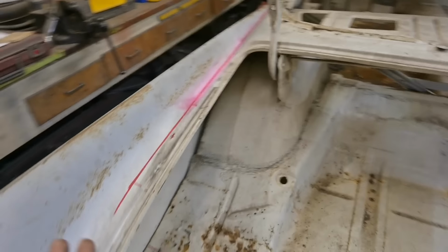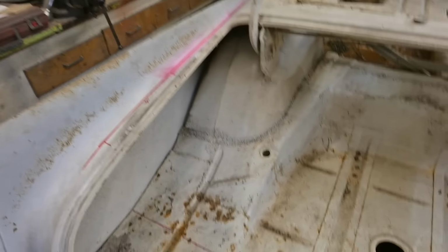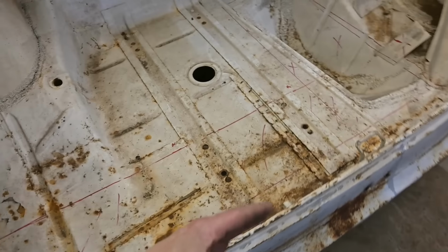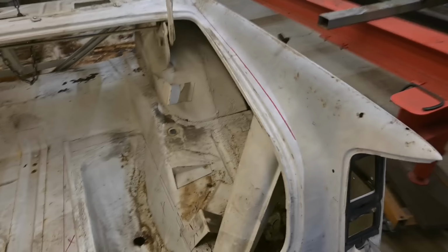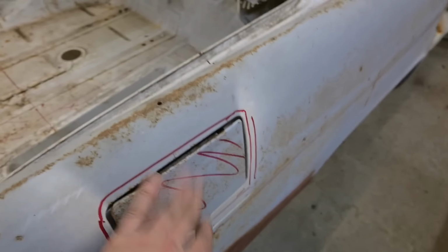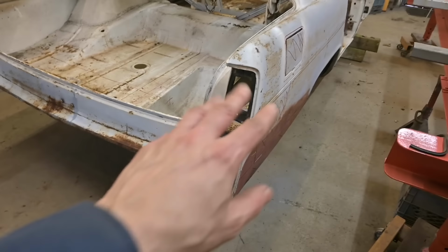The trunk area is a little bit tricky because we have a section in the trunk lid that we need to remove as well. The 10 3/4 inches, whatever it is, that's coming out of there also has to come out of the trunk floor so that the rear edge is pulled ahead. The spare tire holder, that's gonna be deleted. The filler neck, again, deleted because I don't want this fuel door that really doesn't fit too well to the body. It looks like an afterthought. Yes, you need a fuel door. It's not a green machine. We might relocate it somewhere else.